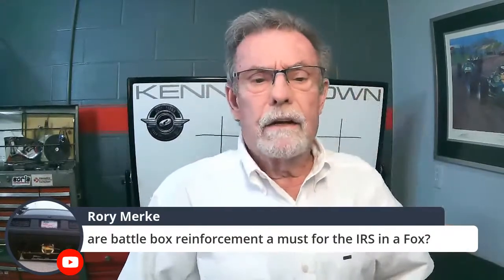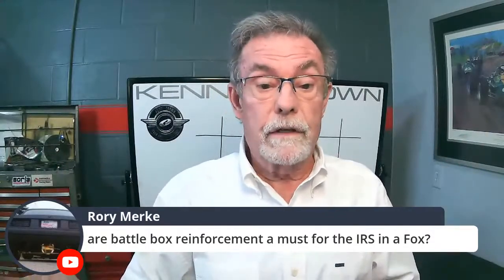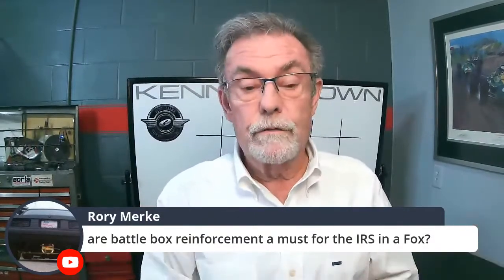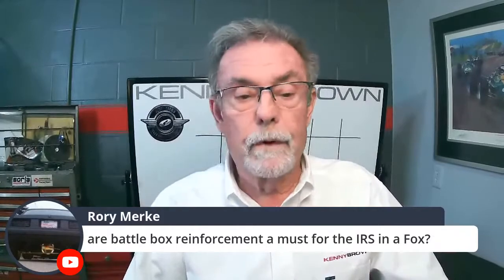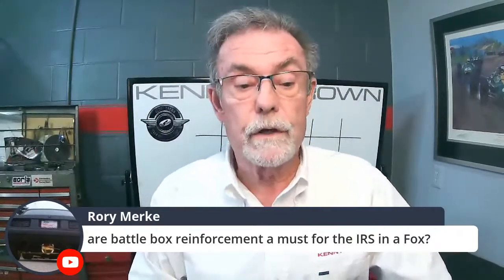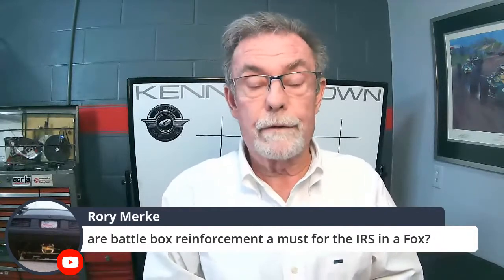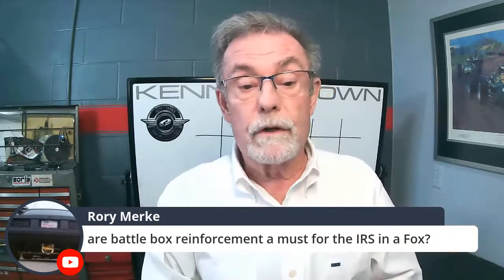Back in '99 and 2000, when the Cobra first came out, I was ecstatic to see an IRS because I'd worked on IRS cars back in the '70s, not only the Formula Fords and Formula Atlantics, but also the Triumph Spitfires and TR6 and Datsun 240Zs. They all had IRS, so I was really familiar with it. But the drag race people back then were pulling the IRS out and putting live axles in, which is the correct thing to do. If you're going to go drag racing, you need a live axle because you actually dial in anti-squat. And it's really hard to get significant anti-squat into an IRS car just because of the architecture of the geometry. So we haven't had any need to do any battle box reinforcements.